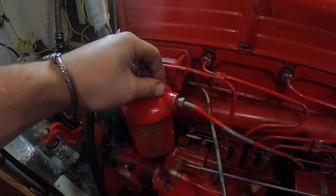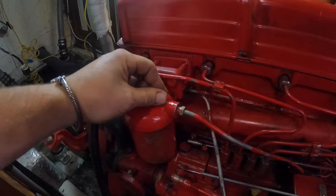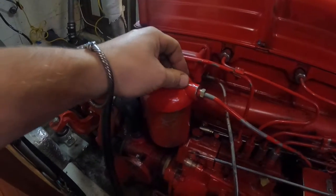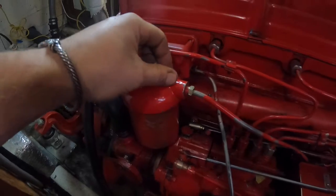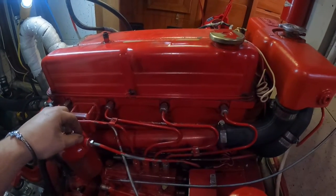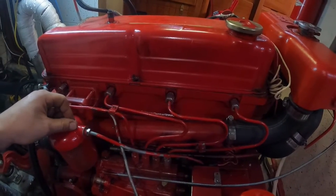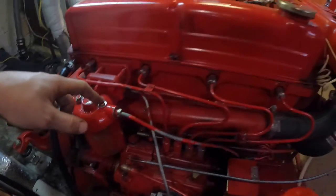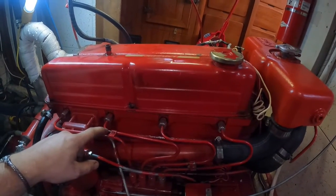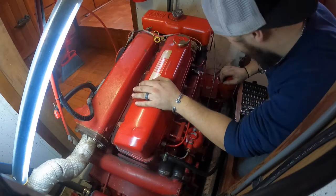I switched out the plunger arm and then flipped the pump 180 degrees — this line is supposed to be going to the engine and pushing fuel, but it was actually pulling. After flipping it around we're now getting fuel up. One issue we found was the hard start I mentioned. Now that I've got good fuel pressure, I can see this bleeder nut on the fuel filter is fully stripped out — I went to bleed the lines and when I tightened it, it just kept spinning. Someone blew the threads out before, and that might be my culprit for the hard start, just sucking in air. So what we're going to work on now is pulling the injectors and sending them out to get rebuilt.